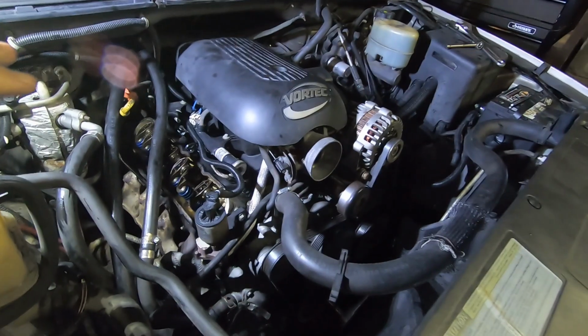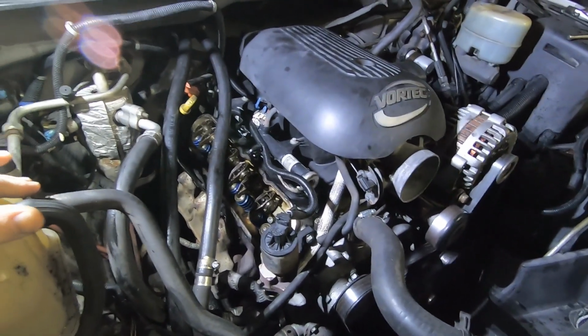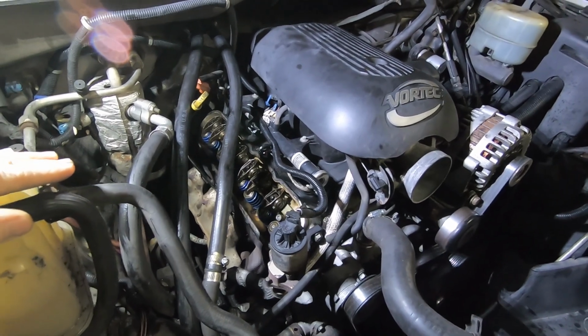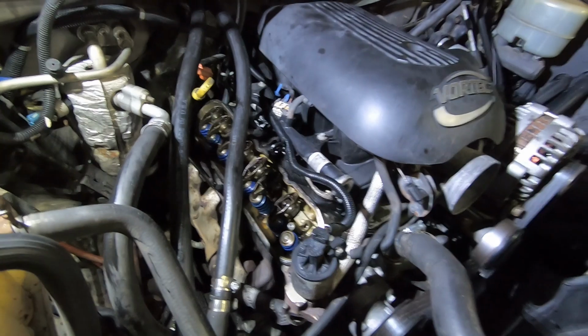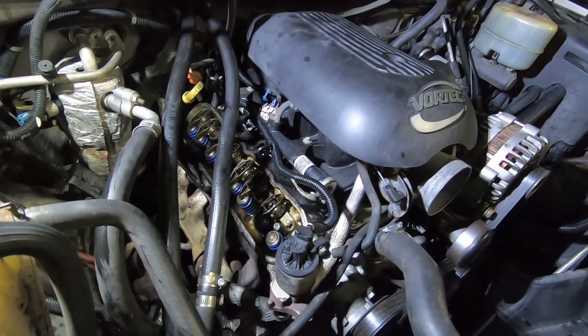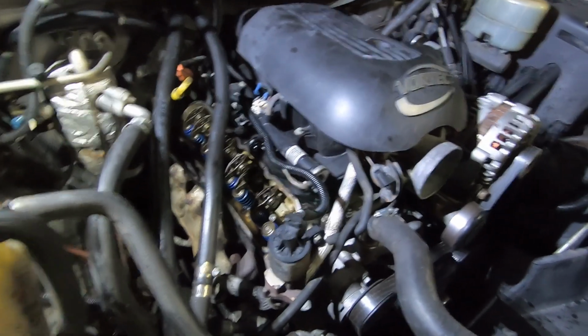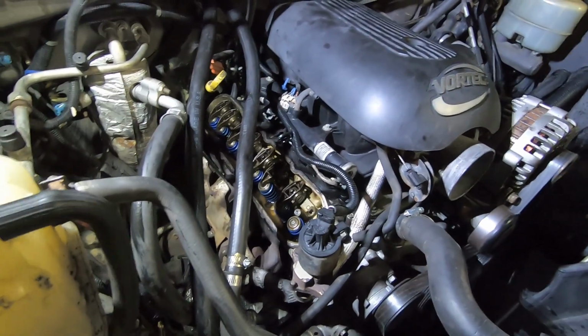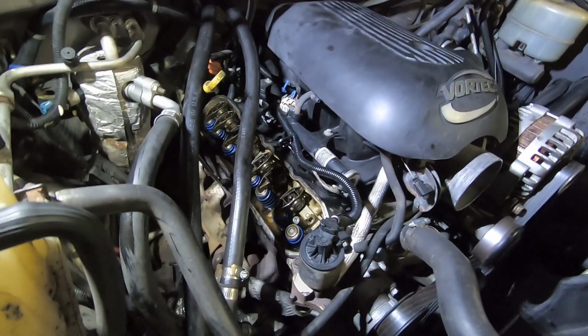Everything else is pretty much buttoned up. You know, a couple of things on the front of the motor. We were getting ready to fire this thing up and hear it, but we definitely got to get longer push rods. So always a good idea to check your push rod lengths. And you never really know. The newer cams, especially from Texas Speed, they grind everything in-house now, and it's a little bit more controlled. But to be 100% sure, you got to check your push rod length.